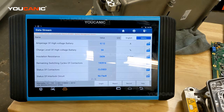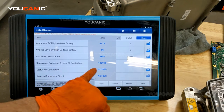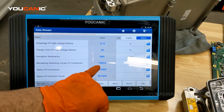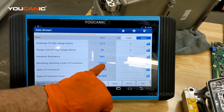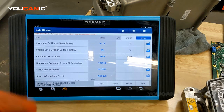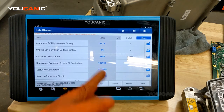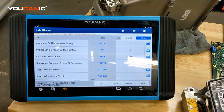If I turn off the ignition, the contactors will go from closed to open. In normal operation they're closed; when you turn off the ignition they switch to open. Something very interesting to point out: if you look at the remaining switch cycles of the contactors, there's a number here — 192,916. What that means is those are the cycles of that switch. Imagine the light switch analogy — this contactor has been operated around 7,000 cycles or so.